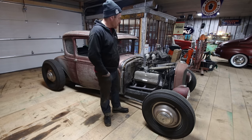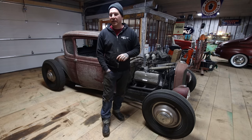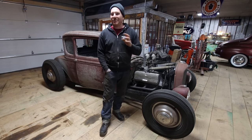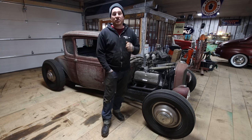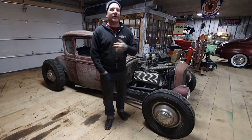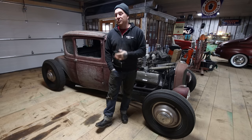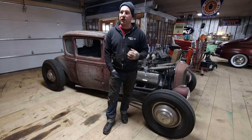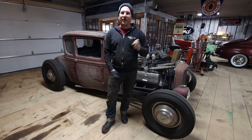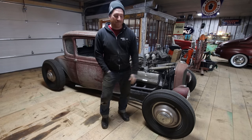The speed equipment is really not what determines the East Coast look — it's really the channel and unchopped look we're going for. The transmission is basically a '39 Ford transmission with a shortened driveshaft, pretty standard for early flathead-powered vehicles. It very much drives like an old raw hot rod with that Model A rear suspension and hardly any sound deadening. It's quite loud but really fun around town. With the 3.78 gears in the rear, it's more of a zip-around-town car — you can take it on the highway but at 60-65 mph it's buzzing pretty good.